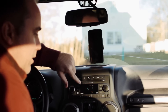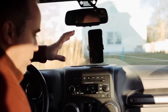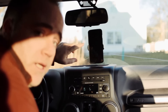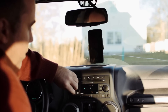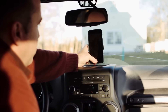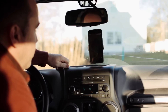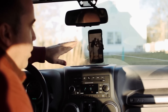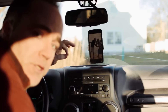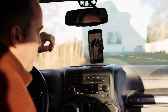Once you've confirmed the version, you're good. It may ask you to reconnect the card — don't worry about it, it will still work. You might need to reconnect your phone to Bluetooth at this point. Then just press the button and Siri will respond — 'Siri, what time is it?' — 'The time is 3:25 PM.' Siri is now working through Uconnect. It acts just like a phone call when it closes out, but Siri will work completely with your Uconnect system.